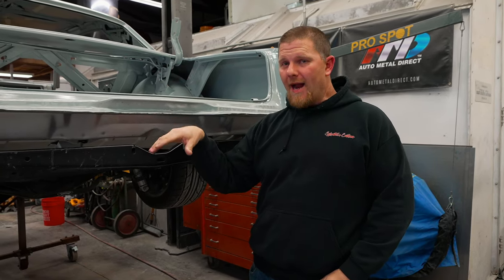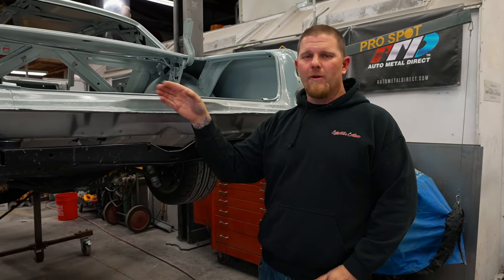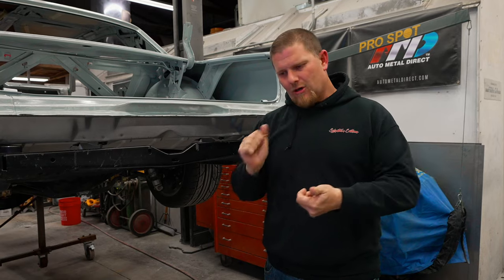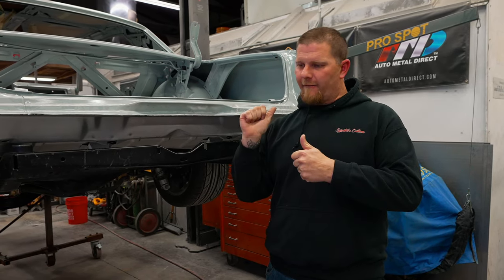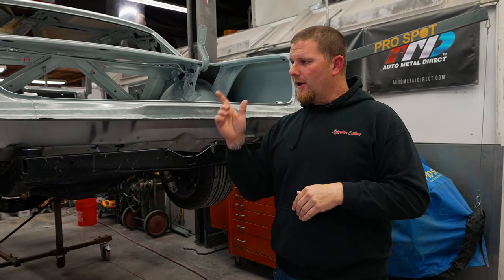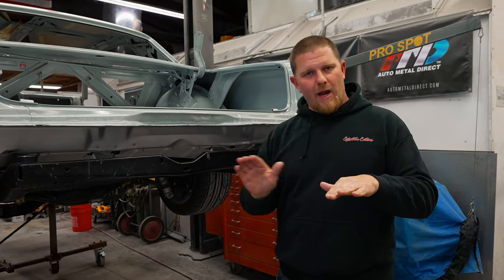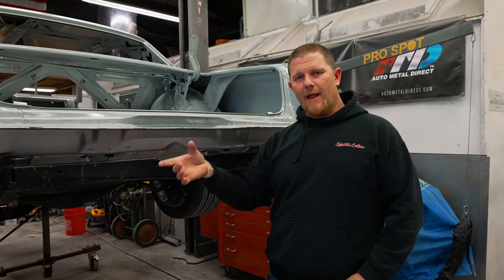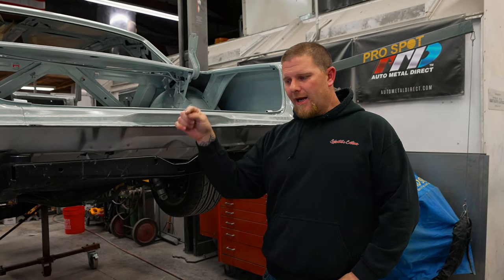Now that we have the car back on the chassis, once we get these bolts in, we're going to use a toe dolly and put it around the edge — that edge we flanged upward — and take the hammer and work that flange back down. You don't want to just curl the edge all the way up and fold it in — work a little bit at a time. Metal doesn't want to be forced in one direction all at once; it wants to be slowly worked. If you've worked it up to a 90-degree angle, slowly work that edge back down, rolling it back and forth with your hammer and dolly. At that point you can take your vice grips or clamps, clamp that plug weld down, and start your plug welds.